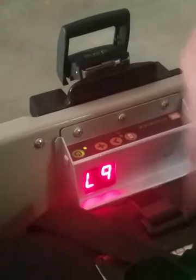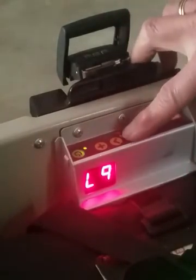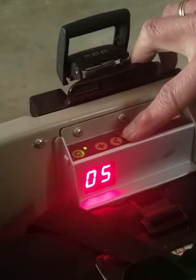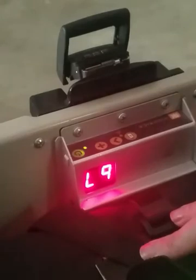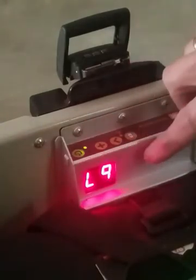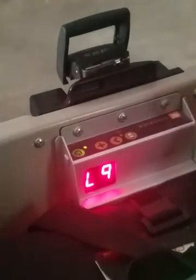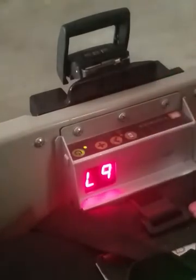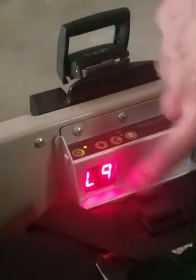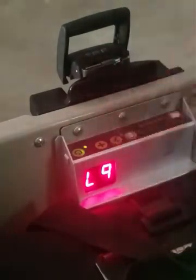When you recharge, you can reset that odometer by holding this button for five seconds. You'll see that 05 go to 00. After you recharge a battery, you can set it to 00 and keep track of how many amp hours are used by the ride. That's a good way to check, especially for lithium batteries, since it's hard to display the exact battery level — so you can keep track of amp hours instead.